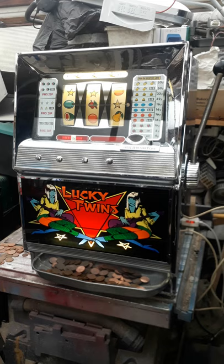But these have come up alright. I've given them a spray and worked them about a bit, cleaned the prongs up, and it seems to be working 99% of the time now. So it wouldn't take any coins at first, and I found that there's a lockout coil that if you put a coin in and then you put another coin in afterwards, it locks that coin out and it just falls back out again. Well that was stuck out all the time, so it was letting all the coins straight out. So I've took that off because it doesn't really need it - it's not going to be in an arcade ever again, and it doesn't affect any play.